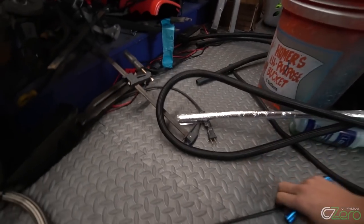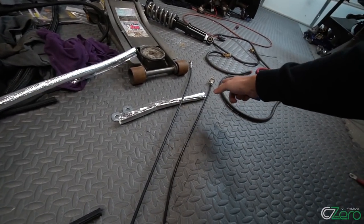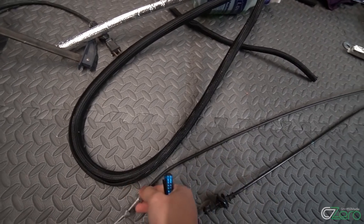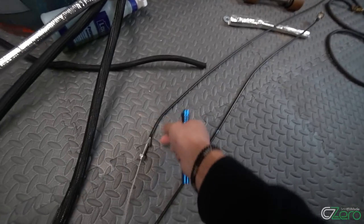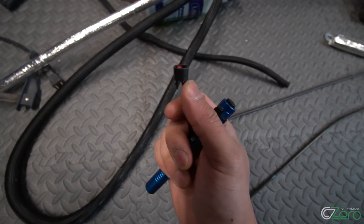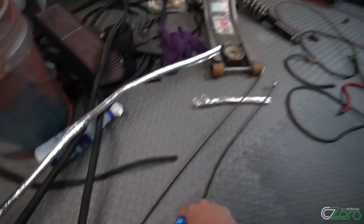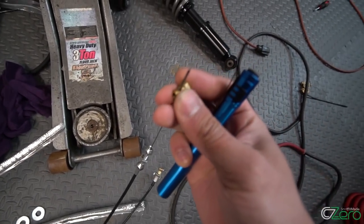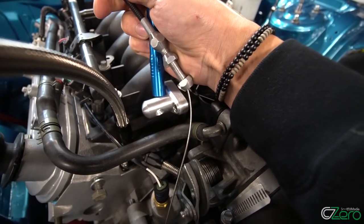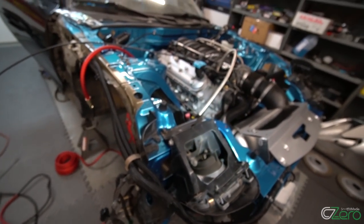Over here I have a throttle cable. I don't know exactly what throttle cable was on my car — I'm assuming it's OEM Mazda or OEM LS. This was the stock throttle cable, and what I did was go with a 48-inch Lokar throttle cable. I took off the stock FD pedal stop — this little plastic piece — and installed it on the new Lokar aftermarket throttle cable. The back end is adjustable: remove an allen key and the gold piece slides up and down to adjust the length as needed. It will be mounted here on the Lokar throttle body throttle cable mount.